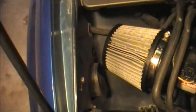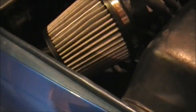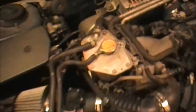When you look at this, when it's all done, it sits really close to that fender wall. I'll try to get you a comparison here. But yeah, it's really snug in there. So that makes it easier to just deal with that afterwards. Put this on last because it's the easiest part to do. Put everything in, like I said, test fit it, make sure it gets in the spot you want it, tighten all the bolts down, then throw that filter on last, and you should be alright.